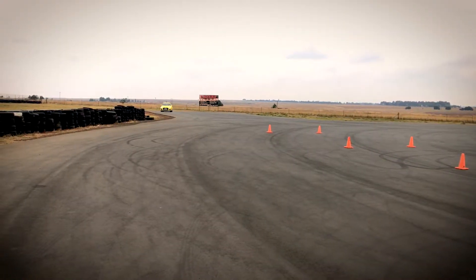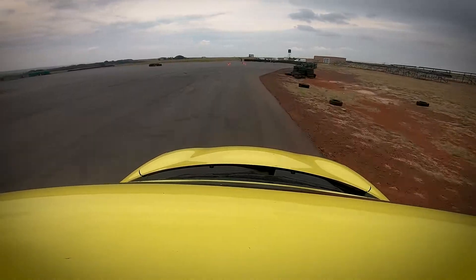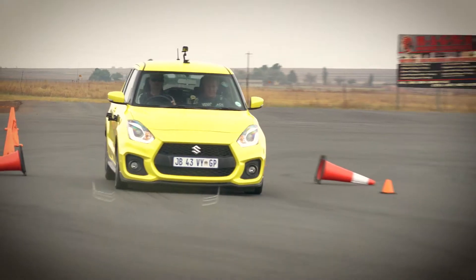We want to get to about 60 km/h. Now we're going to demonstrate with ABS and EBD active. What EBD does is distribute the brake force properly front and rear, and it's also going to stop the wheels from locking up — you noticed I had to come off the brakes earlier. Look at the difference. I felt that — that mechanical feel. Yes, that's the ABS pump taking away and adding fluid to the brake calipers, so it's like pumping like this.